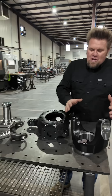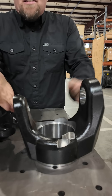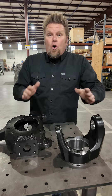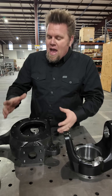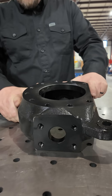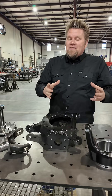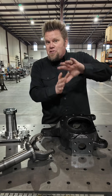The KP540 kit starts with an all-new heavy-duty axle end forging or inner C that's designed to accept kingpins and lower bearings like an old-school Dana 60, but it's so much larger and so much stronger, and integrates with this huge knuckle that basically bolts onto it. The knuckle is designed to fit that larger 1550 U-joint, but the upgrades don't just stop there.